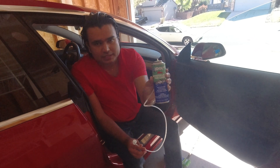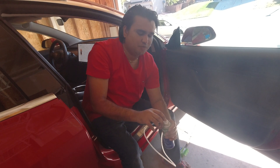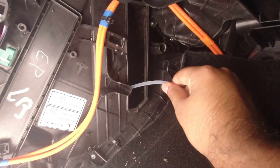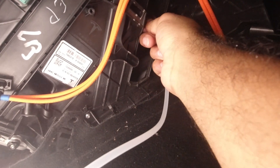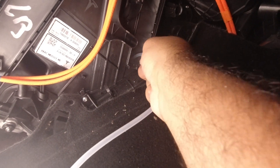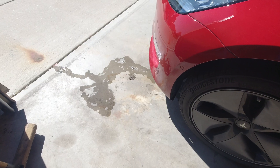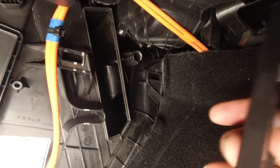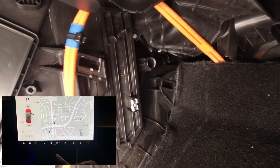As mentioned in the intro, we're going to use the Coolit evaporator cleaner. How it works is they give you a little cap that goes right in here — you push on it and the foam comes out. We put the hose in and press to release the foam, really getting it in there. After about 15 minutes the foam has melted, so we're going to turn on the AC. We'll put the cover back on and let the AC run to get all the evaporator cleaner out of the car.